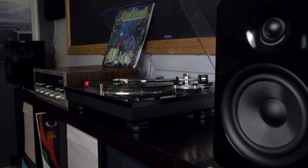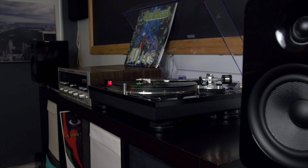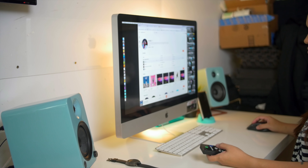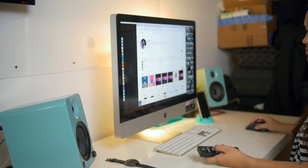When I hooked it up, I did notice that it sounded a little bit warmer — it just had a nicer sound to it, it's hard to explain. What I did notice is that when I used the preamp on the U6s, it didn't seem as loud as when I used the built-in preamp on the turntable and just used the line input. I also noticed the same thing happened with the optical input on the U4s — when using Bluetooth, the RCA analog input, or the 3.5mm jack to the computer, the max volume was significantly louder. I asked the guys at Kanto about that and they said they'd get back to me.